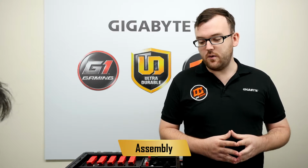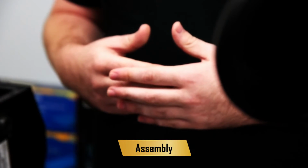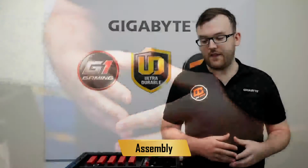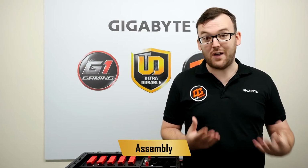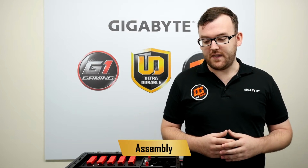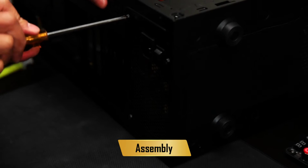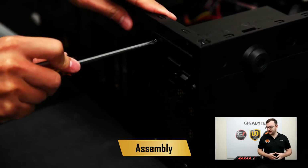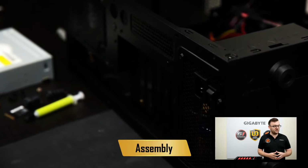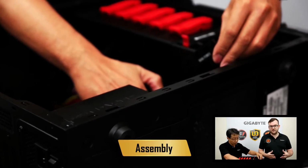Again, with a PSU, you have to have more power than you need. If you say have a PSU that has 800 watts and you need 1,000 watts, you'll have problems. But in this case, we're going to give ourselves some extra leeway because we don't need 1,000 watts with our setup. But if we had more VGA cards and more drives, like a RAID array, we might come close to needing that kind of power.